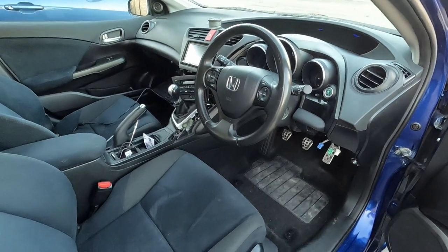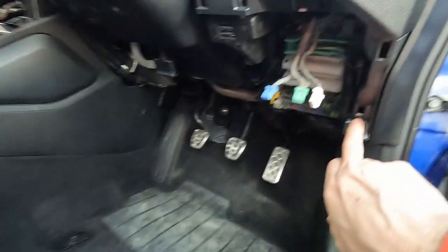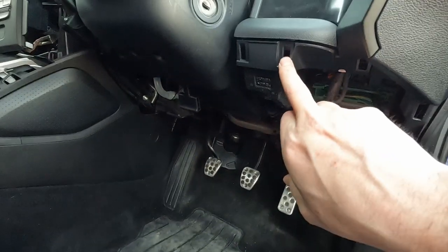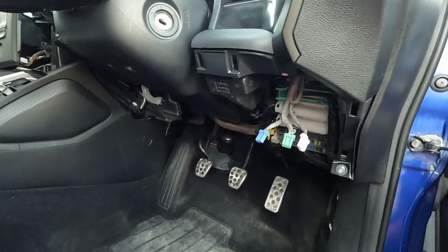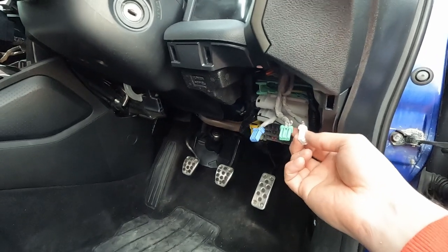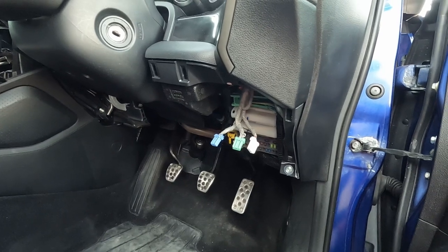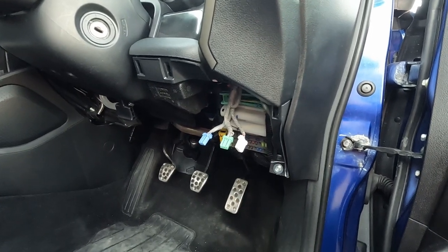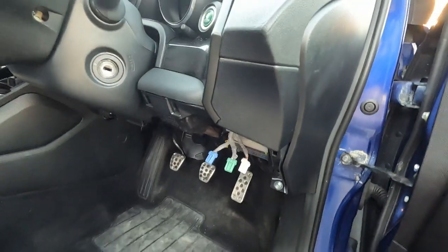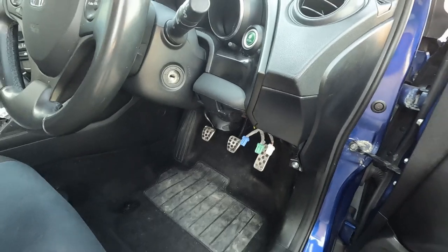We'll start by talking through what I did to get it fitted. The first thing you have to do is remove this lower dash panel here — it just pulls off, there are clips. You can see the two marks there; I think there's one, two, and a couple on the other side as well. You just give them a sharp pull and the whole panel pops off — it's fairly straightforward. You have three connections here: I think it's for the anti-skid, the traction control, and the alarm or something like that. Disconnect those three and that panel comes off.